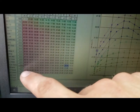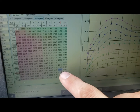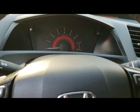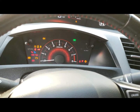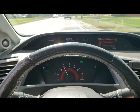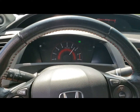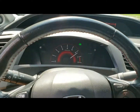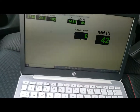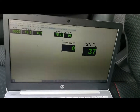So as you can see, about 7,200 RPMs we're going to be at about 21 degrees — it slowly ramps up. At redline I have it at about 12.5 to 1 for air-fuel. So you'll see how much it changes.